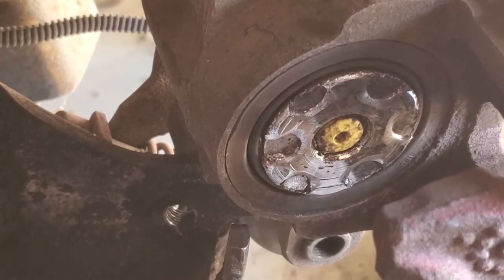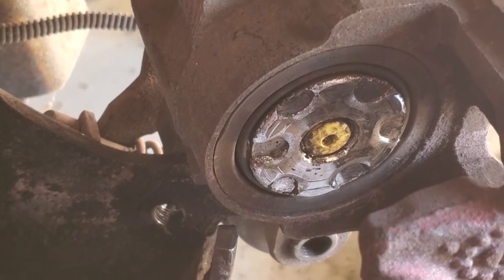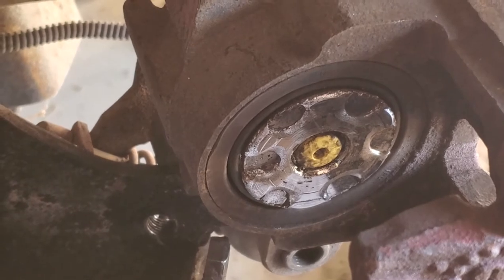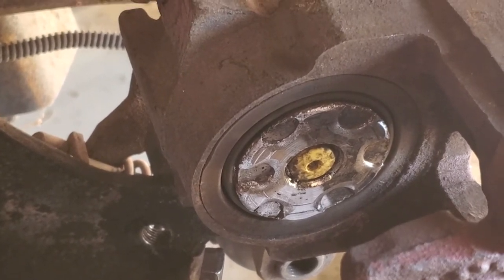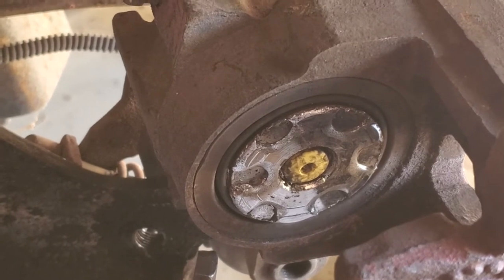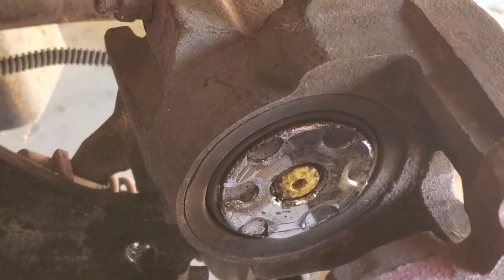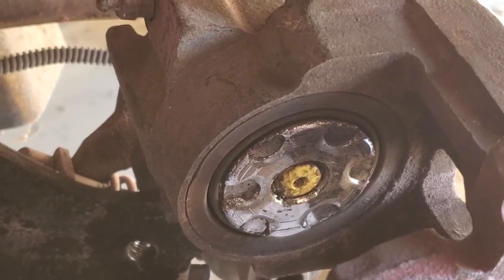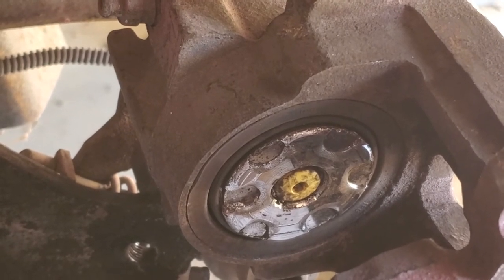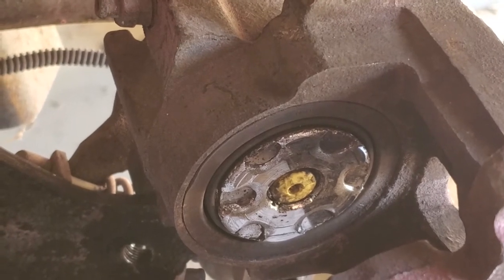And what I've had the largest issue with is right there. The piston on these calipers spins in, but you also have to put pressure on it. Now, I've seen these calipers before. They're pretty common. But the difference on this one is that in those divots, only one of them is deep enough for a tool to really take a bite.